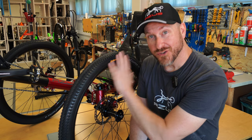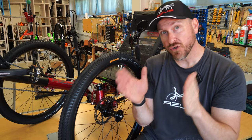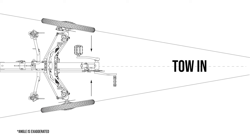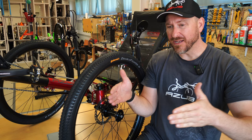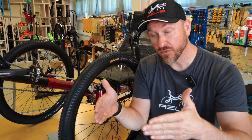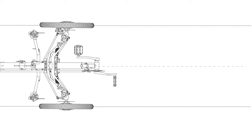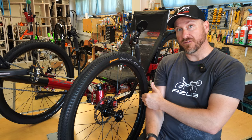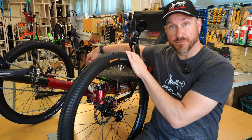Unlike bikes, we have two front wheels, and those two front wheels need to be pointed in a very specific direction to give you proper control when you're riding. If your wheels are too much toed in, you're going to see improper wear on the tire, and it's going to be a sluggish ride because those wheels are pushing against you as you're moving forward.